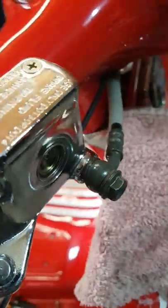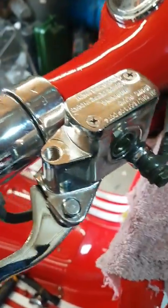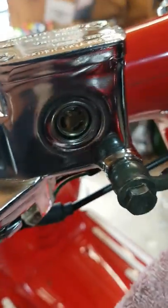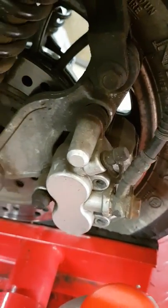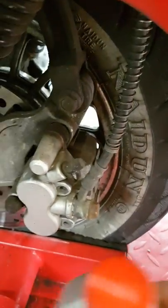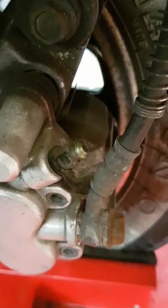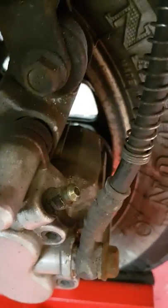This is how we start the bleed. The first thing we want to do is remove these two Phillips screws and then take the top off. You can see in there there's nice clear fluid, but I can promise you in the pipe all the way down it's not going to be clear at all. You can see this has not been looked after. I've got to do a major service all the way through this. We're going to use an 8mm spanner — just remove that cap off. Yours should probably just flick off if it's in good condition; this one is so old it's actually broken off.